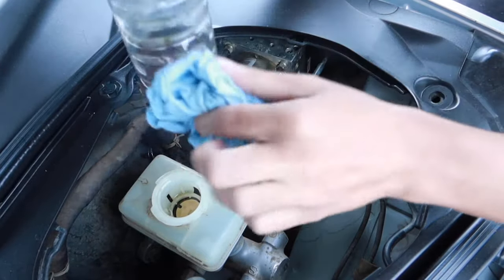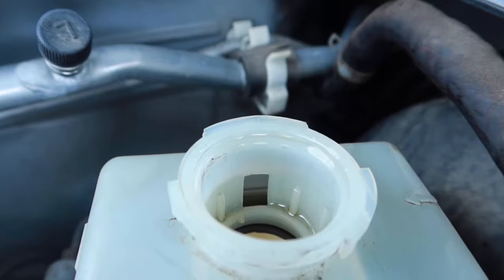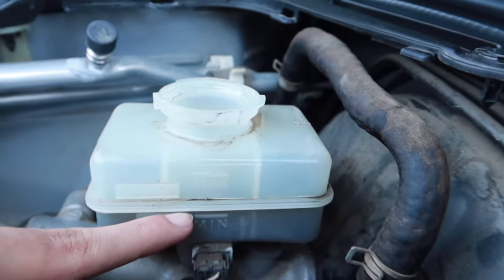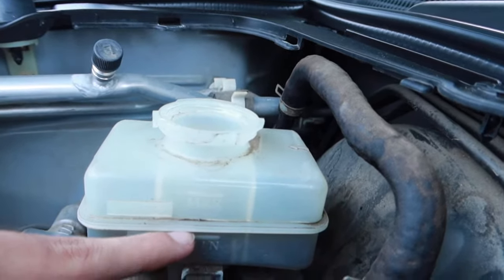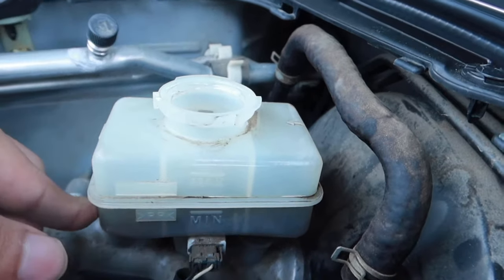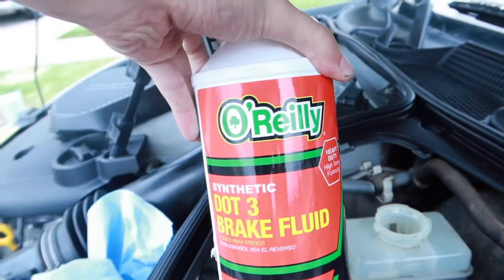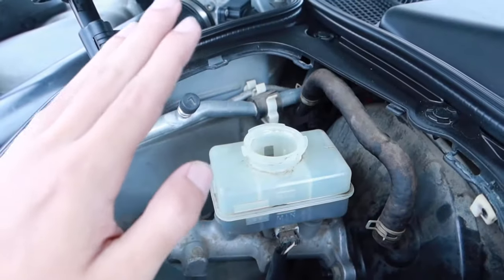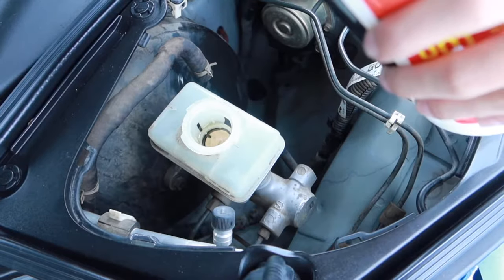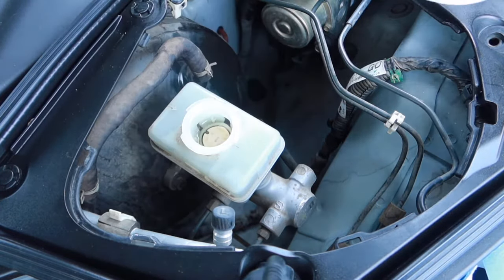Make sure you clean up any spilled brake fluid — brake fluid will eat through your paint like it's nothing. Now inside the reservoir it's just about to hit this outer brim, and you can see the min line is just right underneath it. I didn't want to go too close because we don't know how much of this is actually brake fluid or just dirt that has stained the reservoir. I'm playing it safe and stopping right there, then we'll fill it up with some nice new brake fluid.